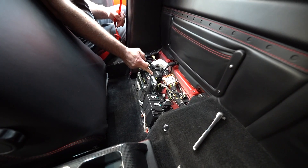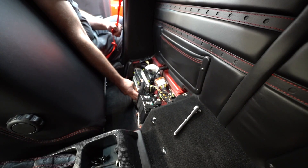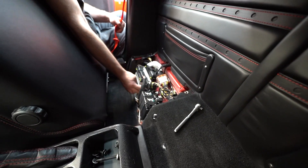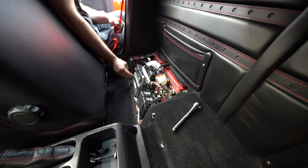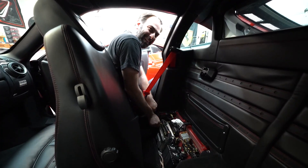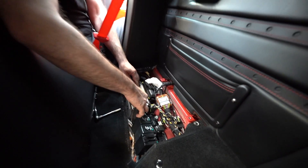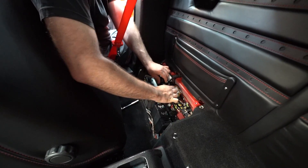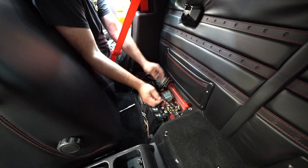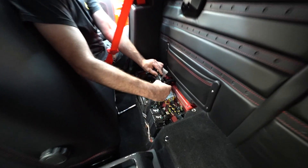The panel pops right out. If you have an F1 transmission car, this is your transmission computer. Behind it here is your right-hand side engine computer. You have two brackets here with studs — 10mm socket on these nylock nuts. You don't have to unplug everything and take this all apart. We can just take two nuts off, loosen the other two all the way, and this will loosen up enough that we can pop the connectors off and pull the computer out.